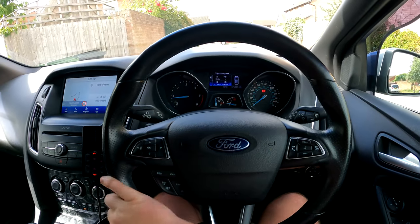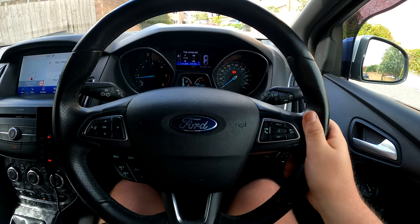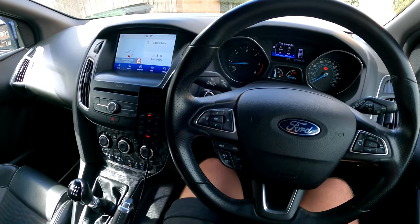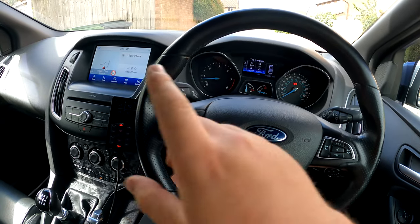We are all done — it wasn't too bad actually for the first time ever changing a steering wheel. The steering wheel is much thicker, much more spongy, I really really do like it. It's annoying because it's reset a lot of my stuff, but it's nice and simple. I would recommend if you're interested in this, just go buy the wheel on eBay, get yourself a clock spring, just make sure it's on zero degrees when you fit it. It's refreshed the interior so nicely — especially with Sync 3 and the steering wheel. Massive thank you to everyone for watching, and I'll see you guys in the next video.